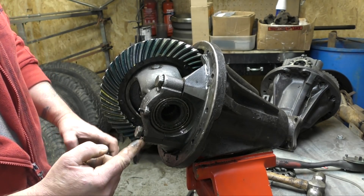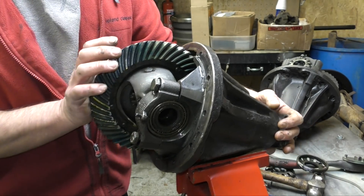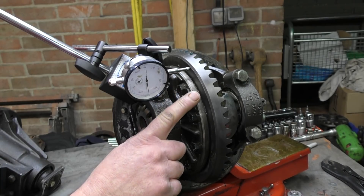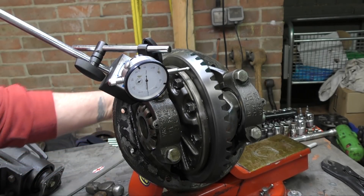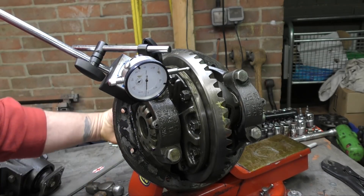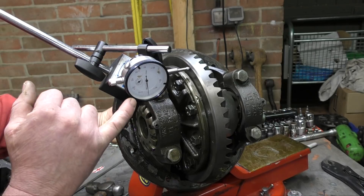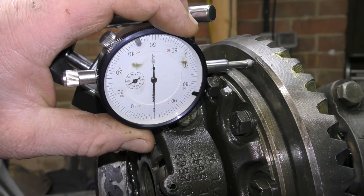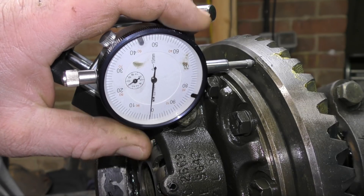It could be because of these caps — either been clamped down too tight, or the housing is actually misaligned. We can usually tell with this dial gauge if we have excessive runout — maybe the housing is not right or it's running untrue.